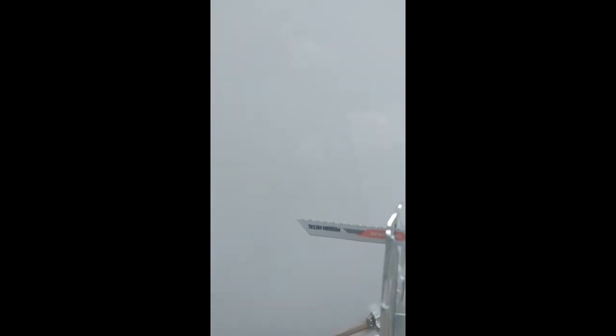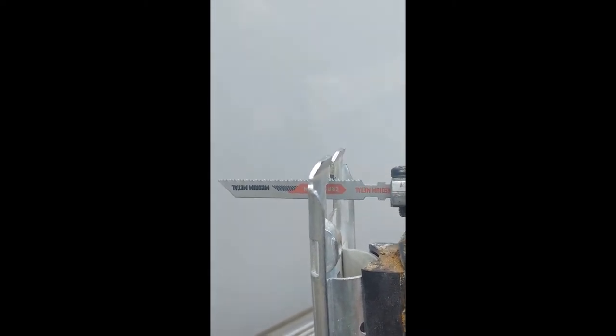Pilot hole cut — you can see I've got my jig in here. One thing to make sure is that your blade on your jigsaw is long enough so that when it retracts it doesn't retract within the width of the door, otherwise when it tries to poke back through you could end up with destruction on the door on the other side. Make sure you've got a long enough blade and start cutting along your trace of the template.